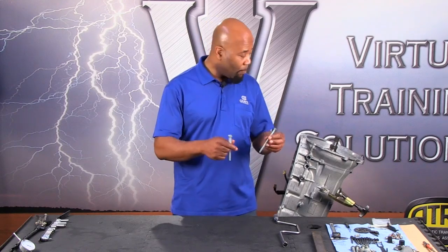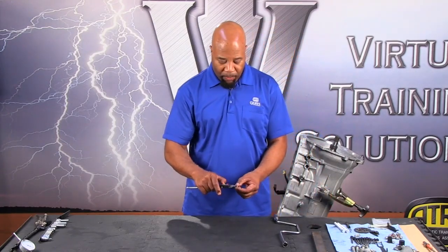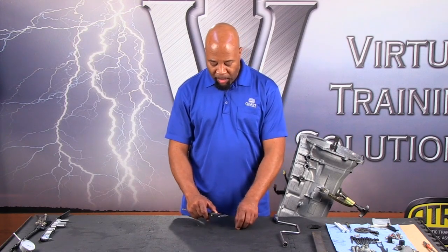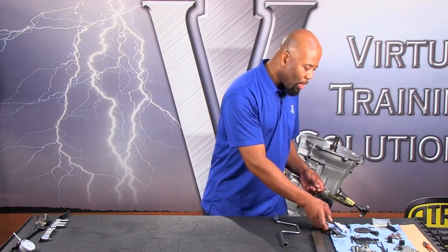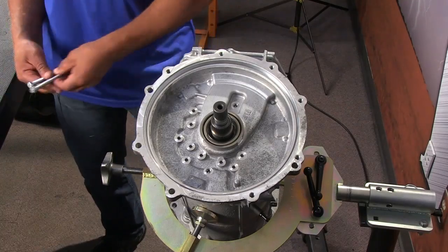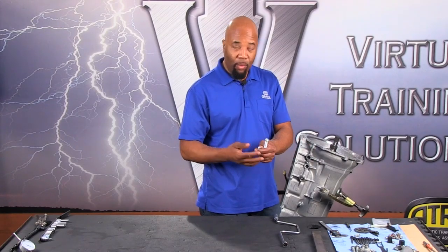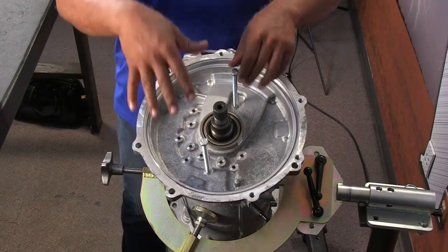You want to get them long enough so that you can go about an inch or so. We got some extra long bolts so we have plenty of throw space. I also recommend using some check balls in the bottom pocket there so that we don't damage the thread and the pump's stator surface. The check balls I'm using here to act as a pressing surface are about .300 inches. A couple of check balls will drop right in there and protect that surface for the stator, since the bolt ends — especially cheap bolts — won't do much for the finish. If you have a nice finish or a bevel on the bolts, they won't pose a threat to damage the stator surface below.